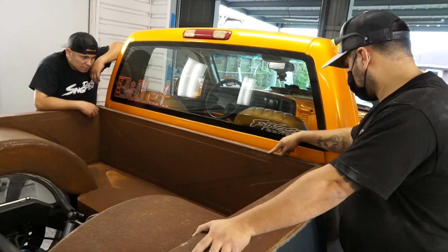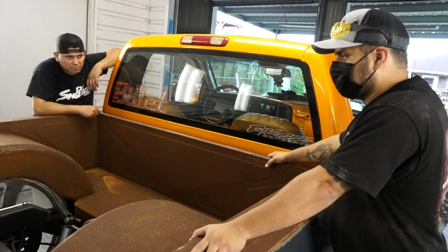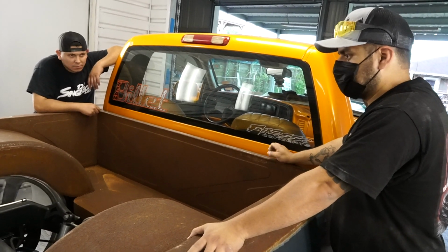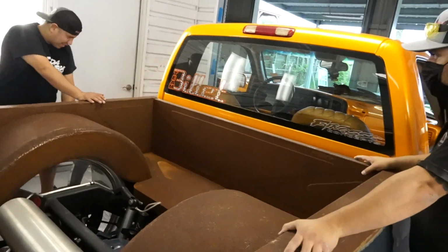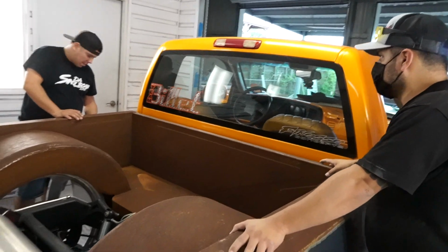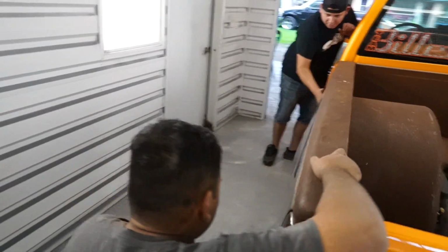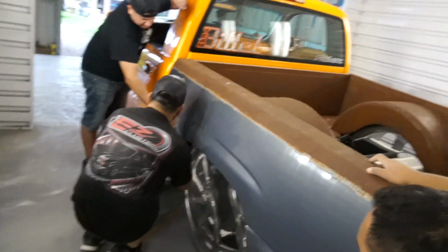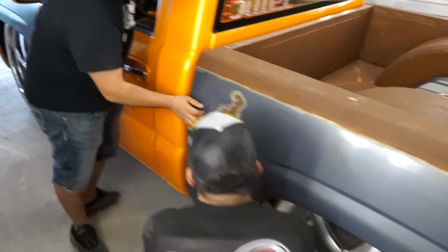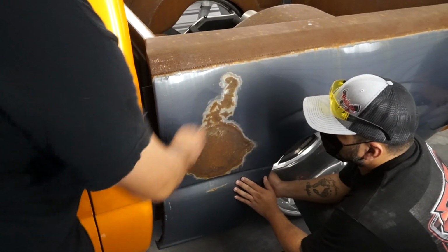Of course, we got to seam seal all this right here. Completely shut. Weld all this completely. And I know certain areas we can seam seal it. And then we're going to need bodywork like crazy. On the side here, because it caved in when they were doing the gas door. And then the bed. Because whenever they started tack welding this, they're supposed to put a rag or something like that behind. The metal is so thin, and they put it on top, so it caved in. Or what do you think? Or can we cut the piece off?